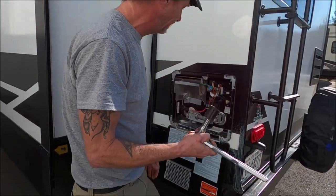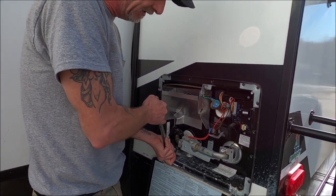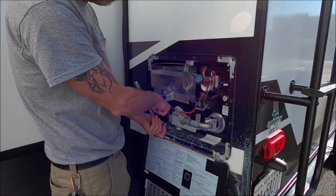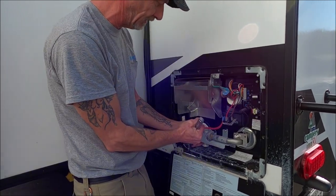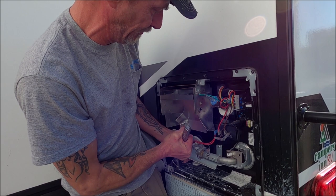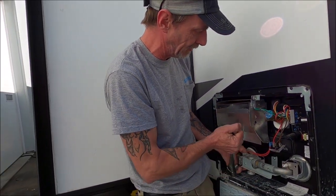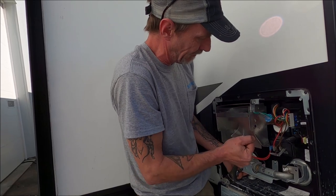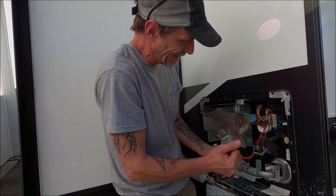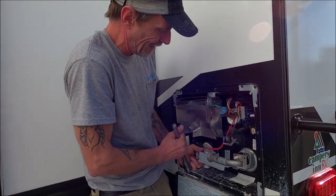The water's gonna come out and pressure's gonna relieve. 15/16ths — that's what it is. See how it doesn't fit? Because this thing moves — this whole thing is just a rubber line with a lot of sealant behind it. What I normally do is get it in about this position here, lift up on it, turn it a little bit, and keep pressure on it because I don't want to strip anything out. It wasn't straight at all when I took it out — it came out crooked.